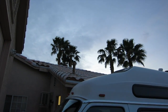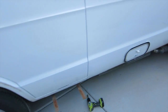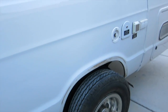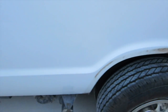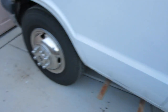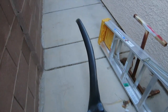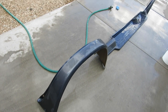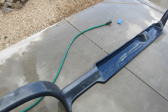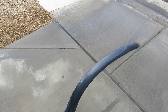It's starting to get dark and I just finished the driver's side running board — took it off. Nothing's easy on the Explorer. Some of these screw heads were stripped out, so I had to get in there with a pair of vice grips to get them out, but I managed to get the driver's side off too. I'm taking a little time to take these running boards and hose them off and get some of the grime off of the bottom of them. It just makes for a cleaner painting process if you wash them and scrub them down first.